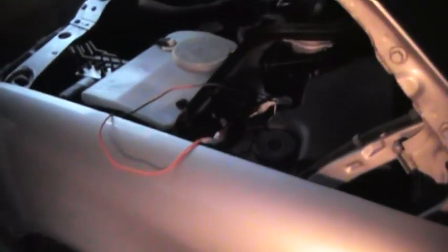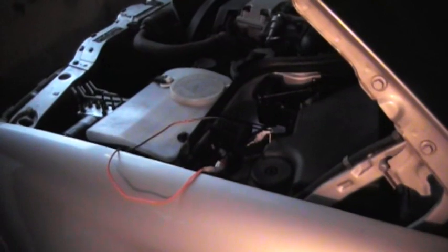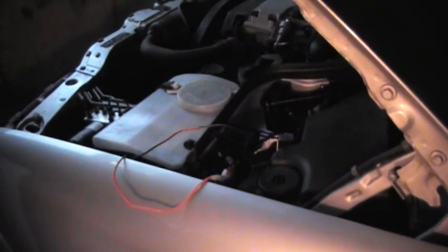Even if I try to zoom out a little and try to flick it, nothing happens and the boot will simply not open. Let me just shut this door. Apologies for being so dark, I don't have a light in here and it's getting kind of dark right now. Trying to open the boot would usually work, but in my case the problem I have is I don't have the vacuum pump working for the central locking.